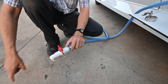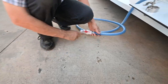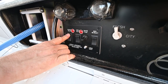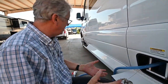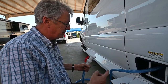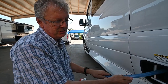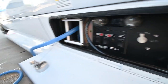This would go down in the sewer, you open that up, and when it came time to dump, you're going to watch the gauges inside. When the black tank's full, open up the black tank. Now I've opened that up, and I would turn on my macerator — this is a macerator system, so it's going to grind, chew, and pump everything through this small hose. I could hook another hose up and run it out 50 feet, or go uphill at least 10 feet. I turn on the macerator here with the waste pump and it'll be pumping that out.